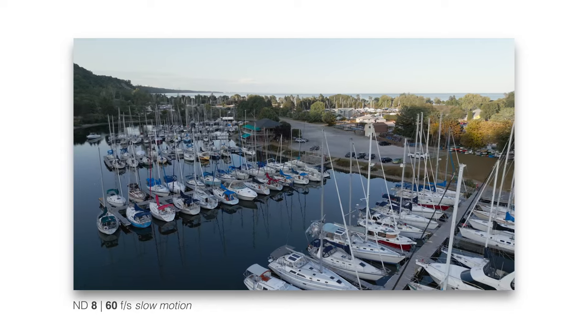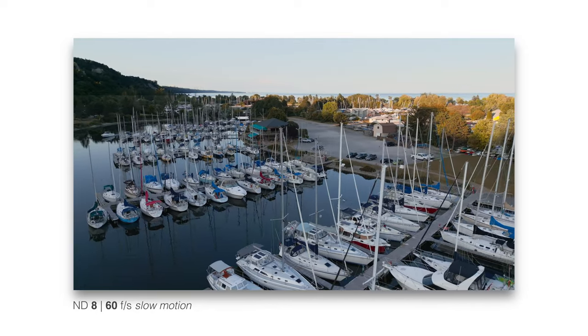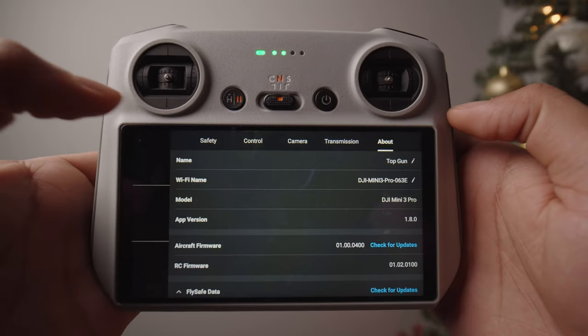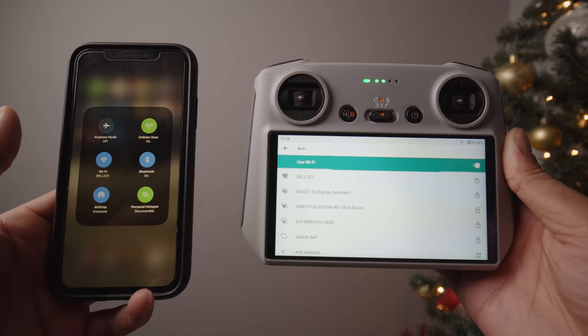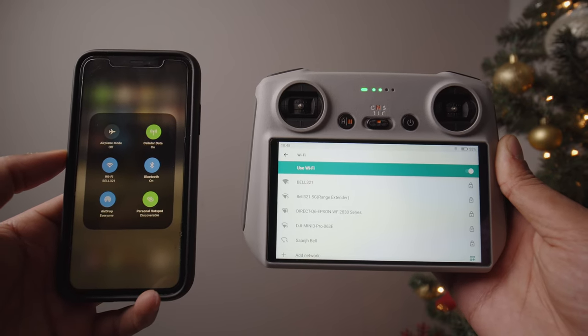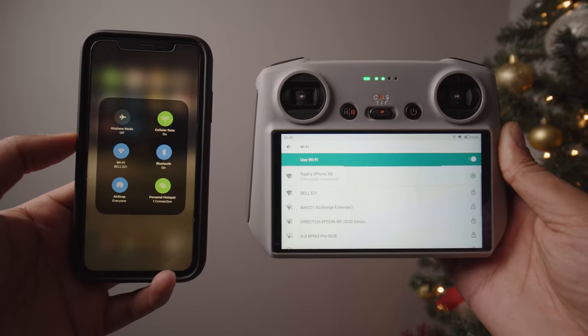This all sounds good, but there are a couple things that I think could be fixed via firmware upgrades. The first is the GPS is still a bit of an issue — it takes way too long to get a location lock, which is really important for updating your home point. When your drone is low on battery, you can set it to return to the point of launch, known as your home point. With the Mini 3 Pro, I'm waiting a while or sometimes won't get a GPS lock at all. The quick fix I found is turning on my phone's personal hotspot and linking it to the controller — it's a pretty seamless connection and it helps speed up my GPS lock.